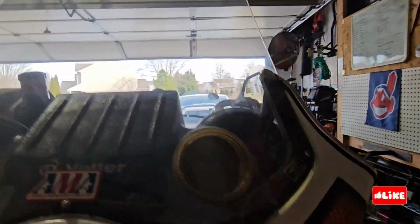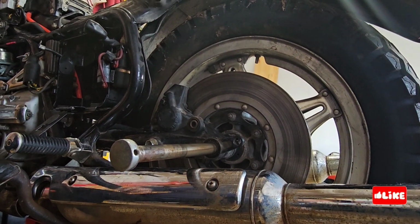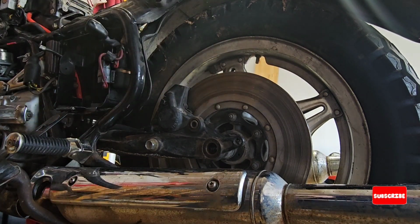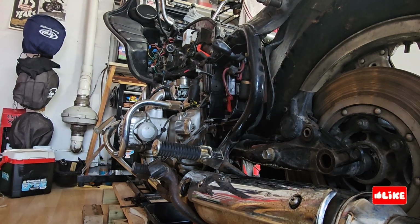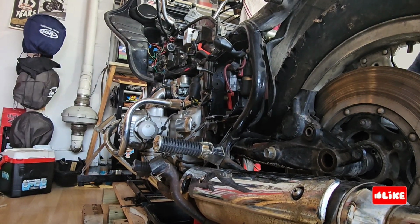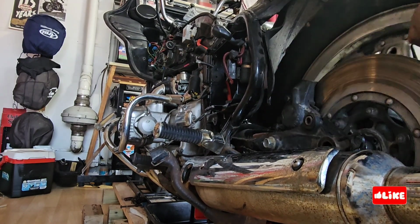Mostly you don't have anything to damage because it's just a hole, but as you can see, now it's on this side, and then you can pull it and move the tire. Also, this is very tight. It looks like every bike is designed to make it difficult to remove things like tires, brakes, lights, wires. Everything is very complicated in a motorcycle. So I cannot take it out because on the other side the shaft is holding the wheel. So for now what I have to do is remove the caliper, you see, because it is not going to go out until I remove the caliper.